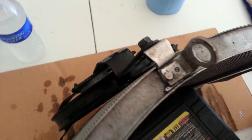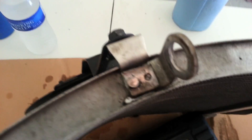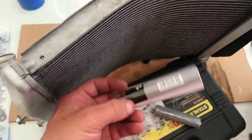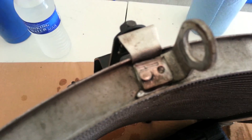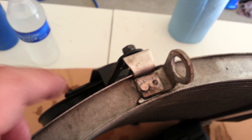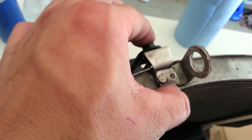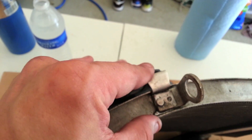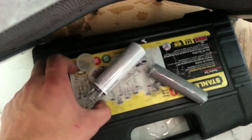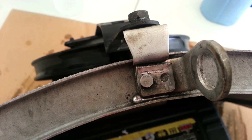Well, that wasn't working out like I had originally hoped. I guess maybe my torch just isn't getting hot enough - maybe you'll have better success if you're trying to do this yourself. So my plan B at the moment - I'm just going to use this JB Weld Steel Stick, which is compatible with aluminum and all kinds of stuff. I just really need something to keep it in place. If it's still moving around I may get some type of clamp bracket to clamp it on each side. That's what caused it to drop down and rub a hole in it in the first place. Depending on that, plan C would be to actually get a buddy to weld it.